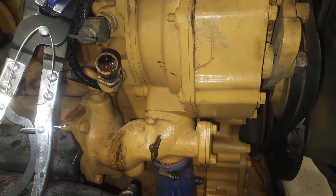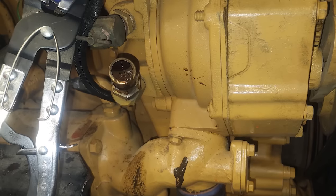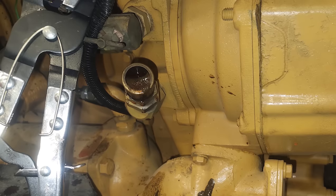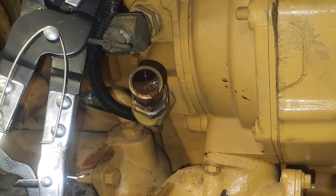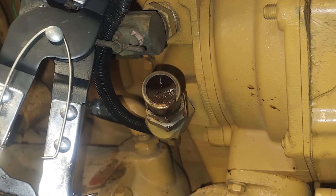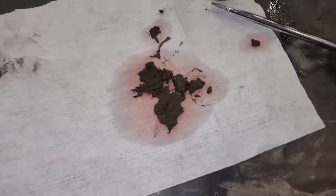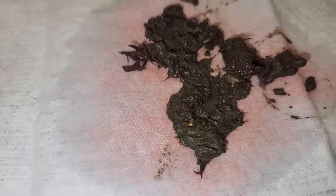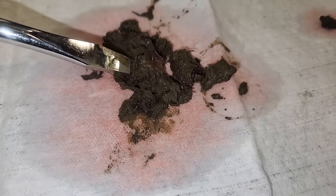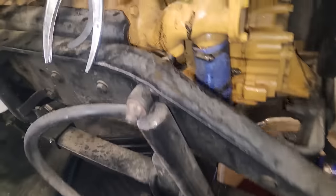The first anomaly I found, other than it not draining all the coolant, was this tube here. This is what they call the shunt line, which is a very important part of the cooling system. The shunt line helps force coolant into the water pump by forcing coolant in from above, and it helps vent air out. It is full of this weird stuff — seems like mud and rocks, or maybe like a shop towel got stuffed in there. This is some of it removed. Not sure how that got in there — maybe someone stuffed a rag in there, or maybe someone sabotaged it.